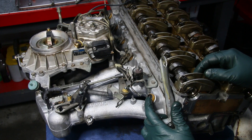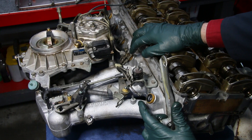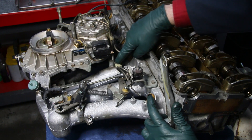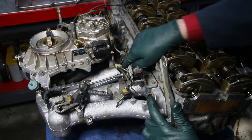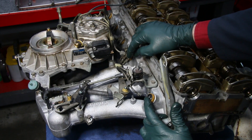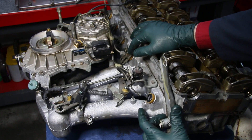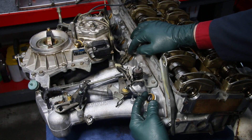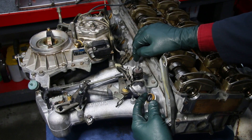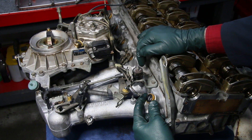On these fuel injection systems you don't want any air intake leaks — not only at these injector seals but all these hoses and vacuum lines need to be secure and not cracked or loose. I'll pull the rest of these out and come back to check whether all the holders are tight into the manifold before we set up to test them.